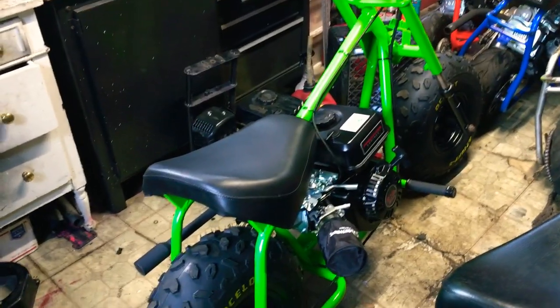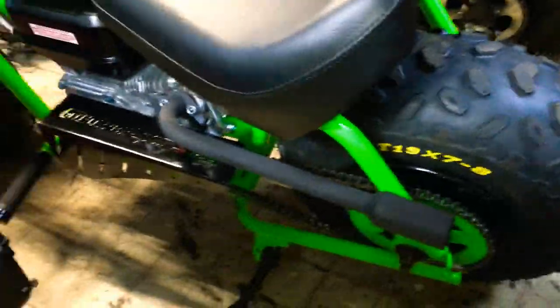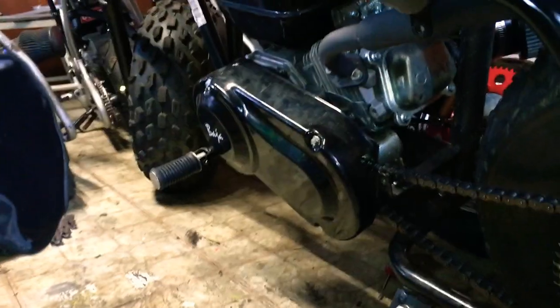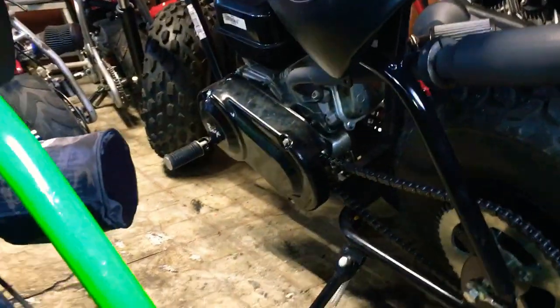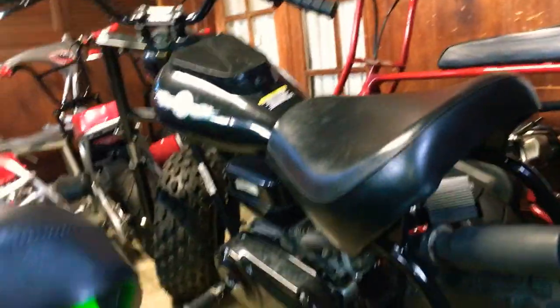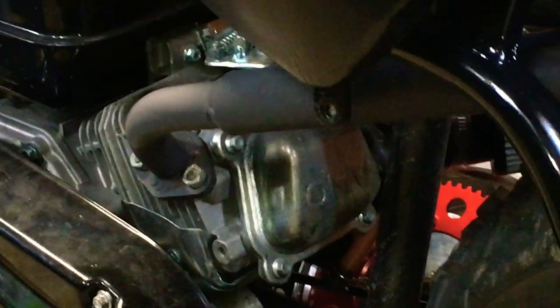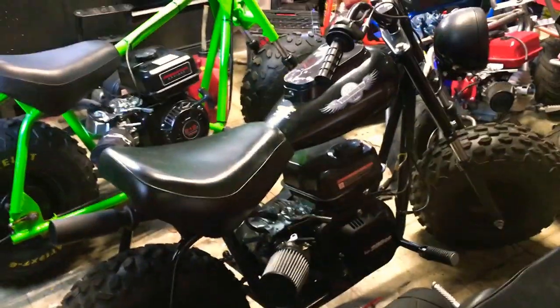I want to go over most of the information I have because I have new information, and this could help guys out with minibikes because most people are so confused about gear ratio, tire height, and all that good stuff. Now, straight clutch — this is another build I did for a customer. This is a jackshaft setup. The gear in the jackshaft setup behind that cover is more for torque. If you were to straight-clutch this, it will lose that torque but will gain at least 20 miles an hour up top. This is for a kid — his dad dropped it off to get a little boost. It picked up some RPMs and quite a bit of torque with the Stage 1 kit. I had a little galvanized steel pipe I had laying around — a second galvanized steel pipe — and this is an RLV muffler. Just black heat paint, basic Stage 1, governor removal. I chopped the fenders too.